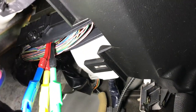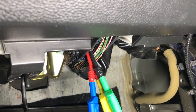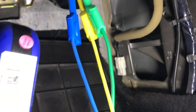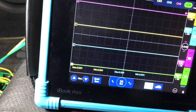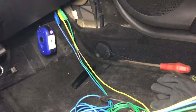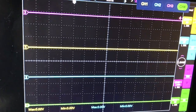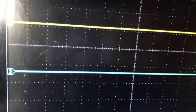I'm going to show you underneath here — doing this from the driver's seat, so bear with me. You can see I've carefully back-probed so neither probe is touching the other, using some flexible probes and Pico leads. The yellow wire will be trace one on the scope — that's the camshaft position sensor on bank one. The blue trace is camshaft position sensor bank two, and the green trace is the crankshaft position sensor.